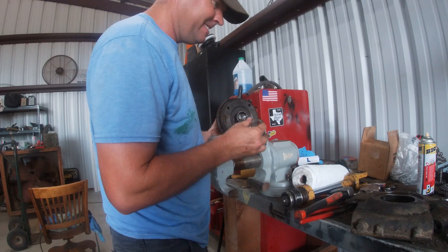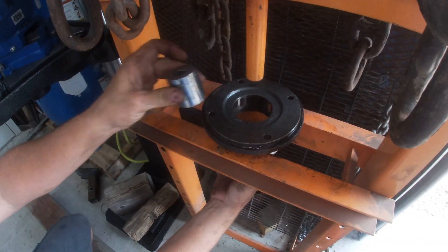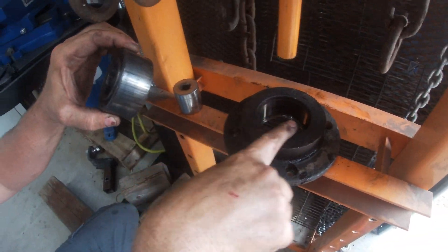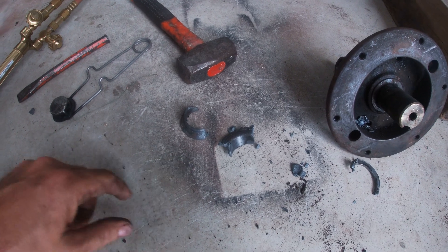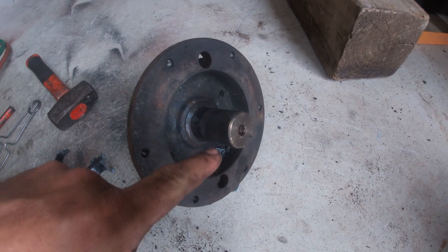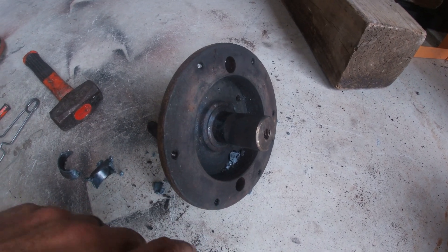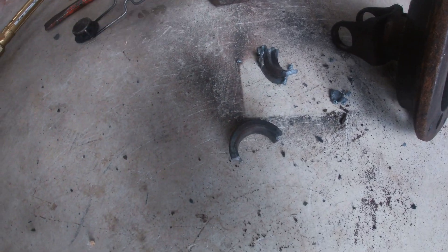It's going to get a new bearing. I had to press this bearing out. There's a snap ring in here that holds this bearing - look how big that sucker is. I had to split part of this bearing race off with the torch. This shaft is supposed to press out of this piece. I even took the u-joint off and tried to press it out with a 12-ton press and I could not get this shaft to budge - it's seized in here. That's fine because this spins with the whole unit, so if I can get a replacement bearing I'll be okay. I found the two smaller bearings at O'Reilly's Auto Parts and crossed them over, but now I've got to find this larger one.